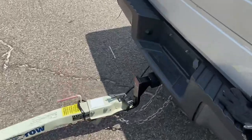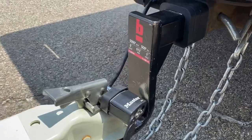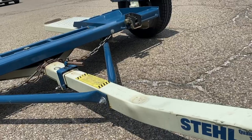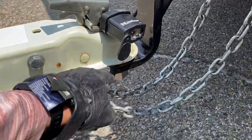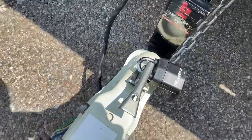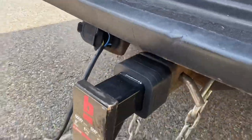First step is to actually hook the tow dolly up. I have a hitch that drops down. The reason it drops down is to keep the tow dolly flat so it's not scraping any curbs. Next, put the coupler onto the two-inch ball, lock it in place, and make sure it's not going anywhere. Then install both safety chains and wiring for your lights. Simple.